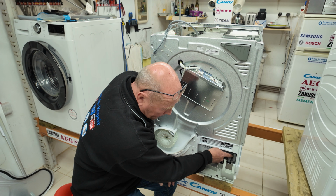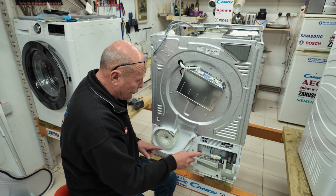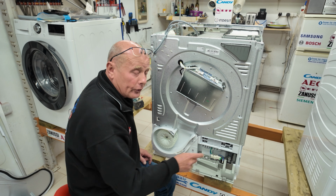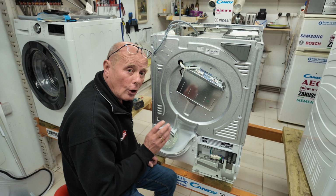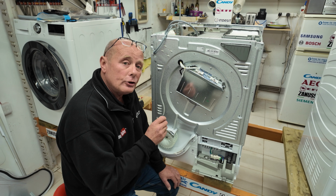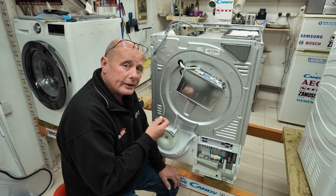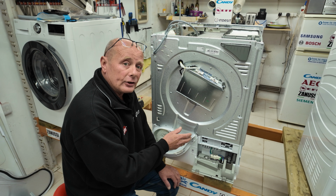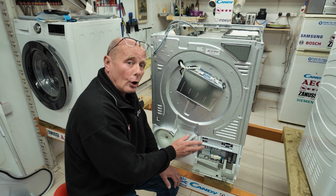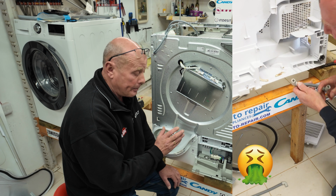You also have one other pipe here that connects underneath the machine, and these two pipes, one from this drain off point here and the other one that runs on the other side, are all prone to clogging, especially, believe it or not, with something like conditioner. When you're drying the clothes, small particles of water that still have a bit of conditioner in them collect in the bottom of the machine, and over a period of time these can turn into sludge and block the pipes. You would not believe what I have blown out of some of those pipes in the past.